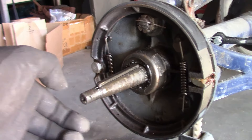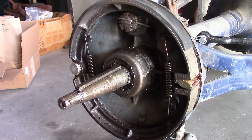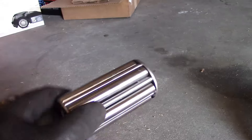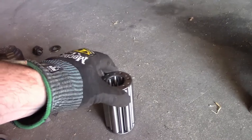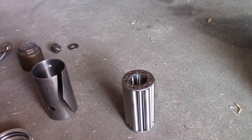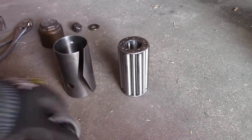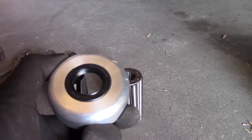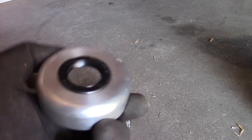This is a big problem I've had for a while — the axle shaft bearings are loose. I put new seals in this a while ago, but they're not really working, probably because of that. So I got a new bearing and a new race. Now, there's a lot of hearsay about these reproduction bearings — some say they're no good or they don't work, and you're better off using originals. Well, the problem is I have an entire bucket full of originals, and every single one of them is worn out to the point where you can't use it. So I need to do something. And while it's apart, I'm going to put another inner seal in it. I just discovered these — this is an aftermarket outer seal that has a neoprene lip seal and O-rings on it. I don't know if these work, but I'm going to try it anyway.